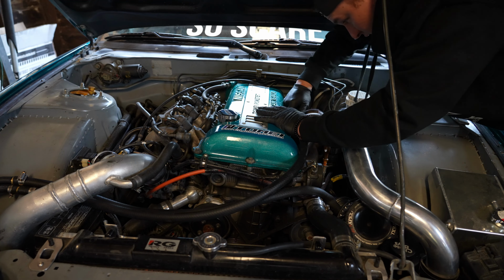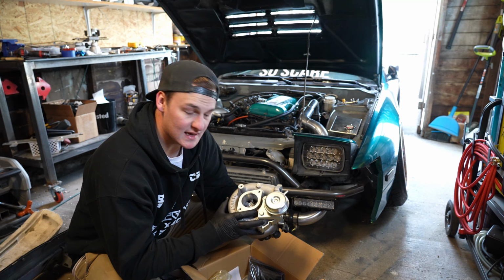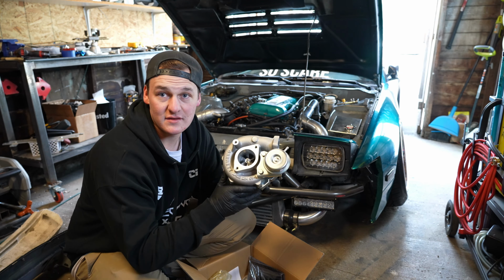This is the Garrett GT2871R from the S15 SR20, the S15 Spec R Turbo. It should have the exact same oil and coolant lines. It should bolt right up. I don't need to go top mount. I also have 740cc Nismo injectors, bigger fuel pump, ARP head studs, all that good stuff. In the next video, you guys are gonna see me throwing this on the car, ripping out that whole hot side and test fitting that, getting the car all ready to be tuned.